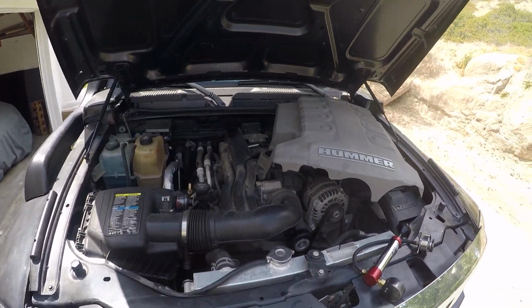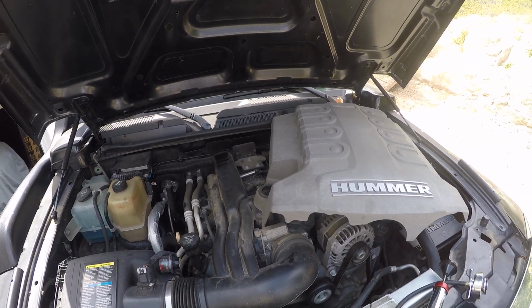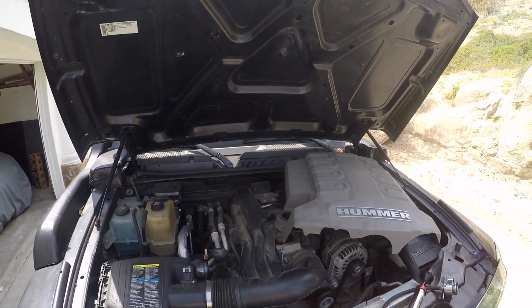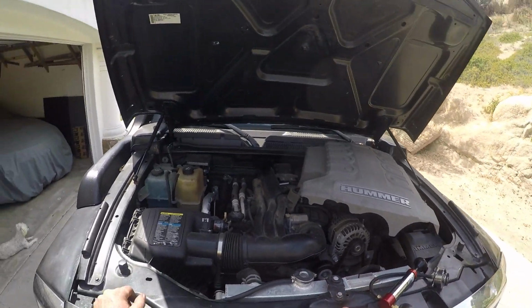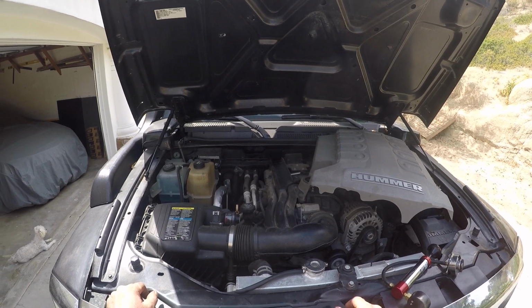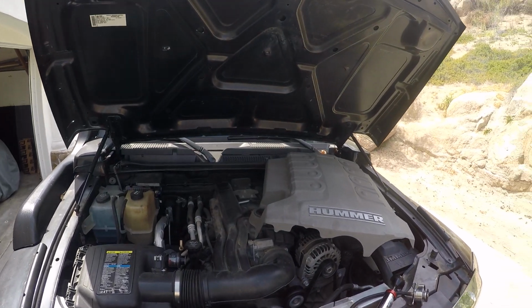Now this one, I'm not even going to mess around. I'm going to say I can't find the leak cold, although I do know where it is. I'd come to this vehicle and say, okay, I need to pressure test this. If you don't have a pressure tester, you can get it warm, and when you get it warm it'll pressurize and you'll probably find the leak, but you also may burn yourself and have no skin and die. So not really practical for the professional.